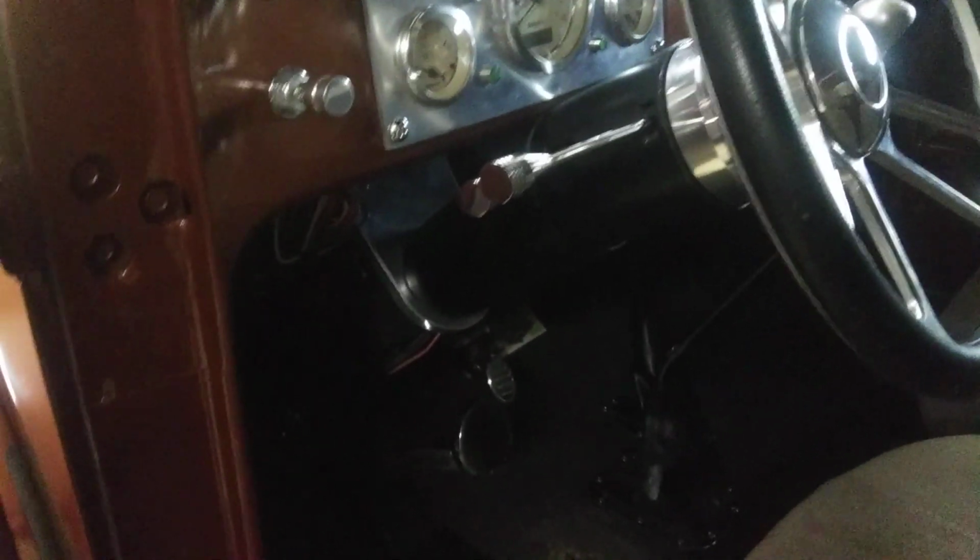So that old '55, this truck was worse. Redid the whole floorboard. You can see, kind of dark in here. I should open the other door. Put the Corvette master cylinder booster down on the floor, to the frame. It comes up through the floorboard. Drop column.